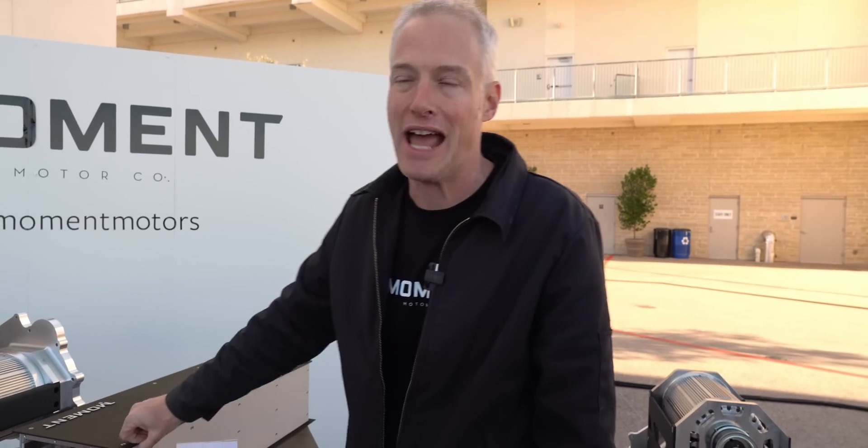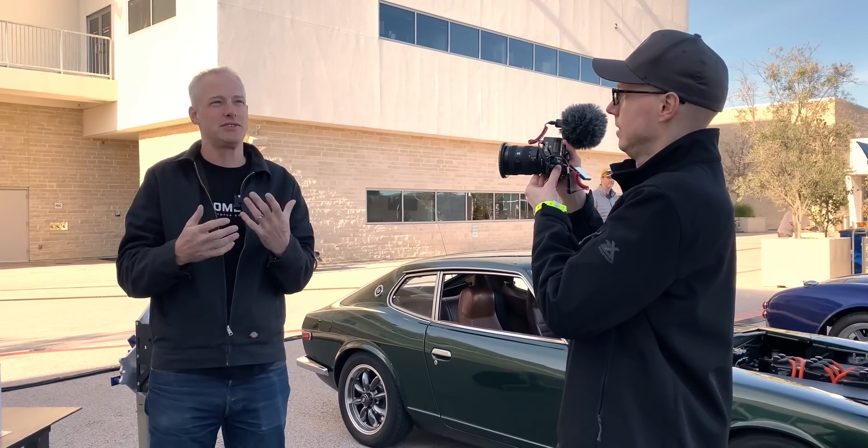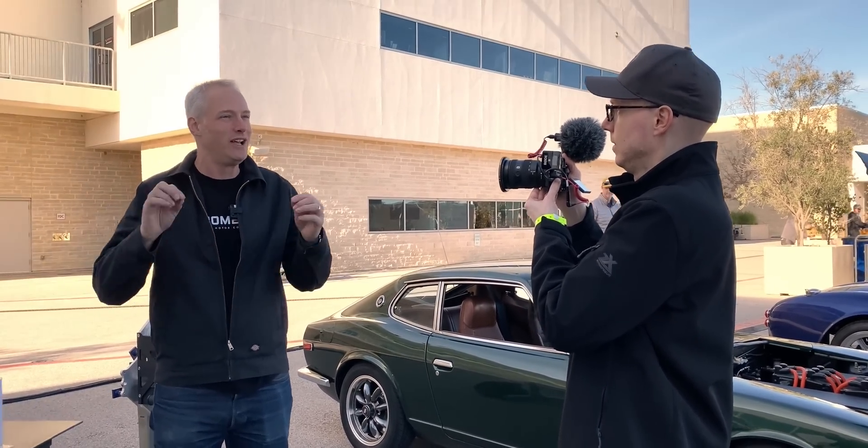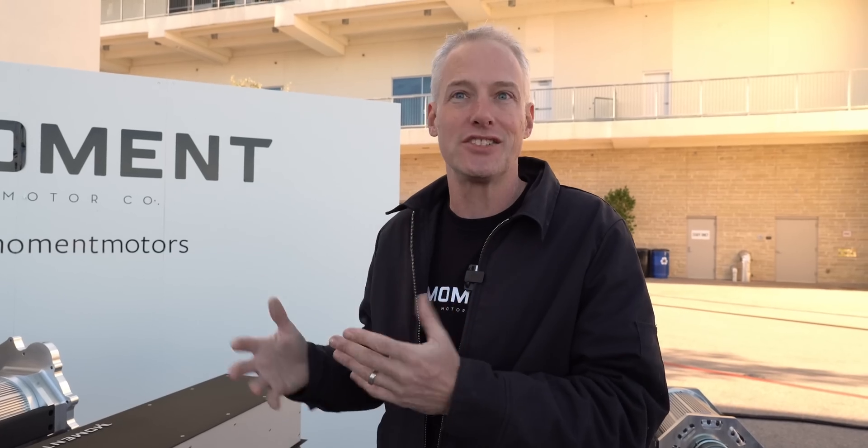Another interesting aspect is that these boxes are not welded together. We use aircraft-grade adhesive and screws to keep it all nicely assembled and rock solid. By not using welding, we're able to keep this very dimensionally accurate. Once you weld, especially aluminum, there's a chance for things to shift around — the heat in aluminum usually causes stresses. This basically allows the box to be exactly as it was designed in CAD and perfectly dimensioned, and it lets all of our components mesh together very nicely.